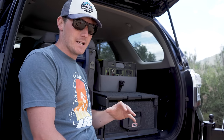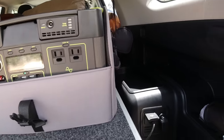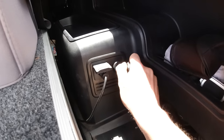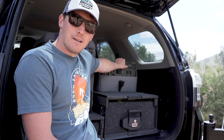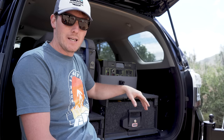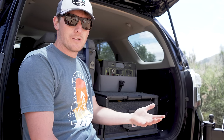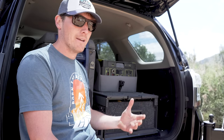As for routing the power, I wanted it clean and simple. Next to the actual power outlet I drilled out the cigarette lighter, installed an O-ring gasket, and routed the cable from the engine bay down through the wiring panels on the side all the way there. It looks almost like it came that way from the factory — you pull it out, plug it into the back of the link kit, and it charges while you drive. When you're done and want to take it with you, you just put the cable back in the O-ring. Now I've got full remote capability — I'm 50 yards from the river right now, and I can just lug the Yeti with me and plug in down there. I don't think I'll ever go back to the dual battery system.